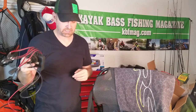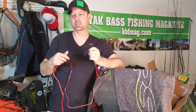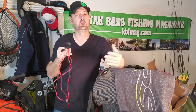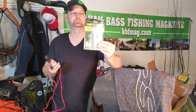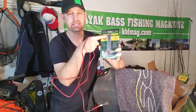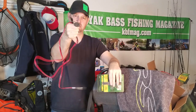What can you plug into these? One of the things you can do is install these SAE male-female ports. A lot of times guys will run 360 lights off the back of the kayak, or power their fish finders off one of these. The power ends of a fish finder don't come with an SAE plug that fits, so you connect this adapter to the end of your fish finder using the included butt connectors, shrink tubing, and SAE connector — heat shrink it to form a good seal, then plug it into where you've mounted the port.